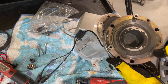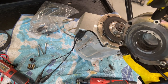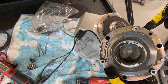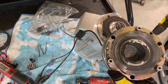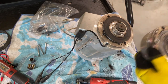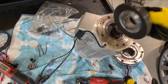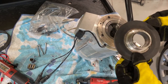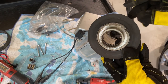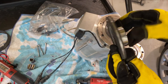These are your mounting points here, and the pressure plate assembly moves in and out on these units. And what happens is the magnet assembly in here will either get burnt up, or stuff will get hooked or caked inside here, and it'll stop working to where when it engages, it won't come back. Here's the clutch, for lack of a better word, basically. I don't know if you can make that out, but there's a huge freaking groove right in here on camera. Anyway, this one's toast.